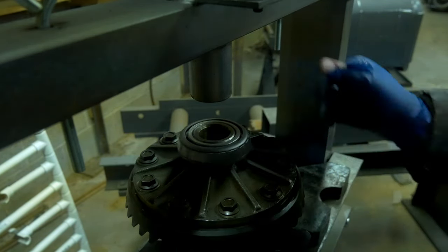So I don't get to show you how to mess with the heel and the toe and the rake and everything else. But if you want more details on that, there are much more differential specific rebuild videos out there that go into a lot more detail with that stuff specifically. As you can see, I'm just painting a couple teeth here, front and back, and then I rotate that pinion around enough times to make sure that the ring gear has made contact with the pinion about 5 or 6 times, and I'll do that in both directions.